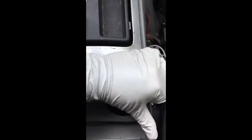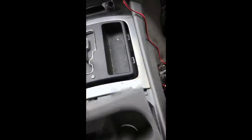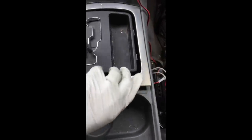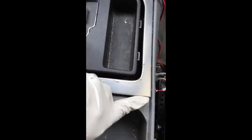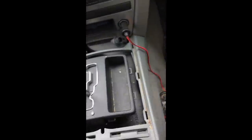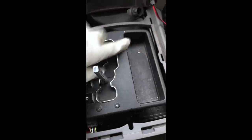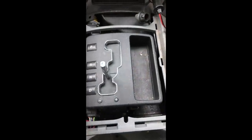The cup holder lining comes out — just rubber tabs hold it in place. This is a good time to clean the car while you're at it. After you take out the cup holders, grab this next trim piece, pry it up — you've got good access right there. Pull it up. That takes out both pieces. Put them aside. This is the ESM assembly we're going to be taking out.